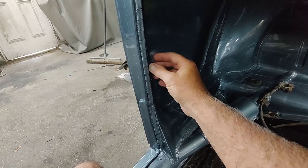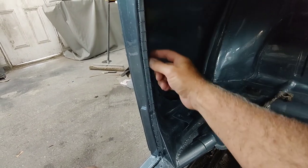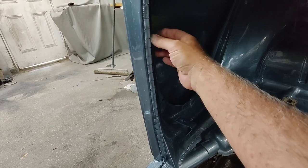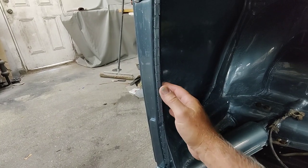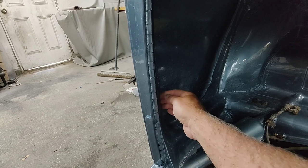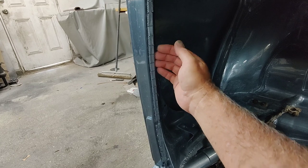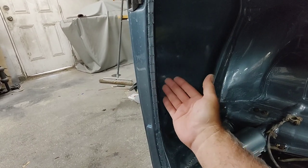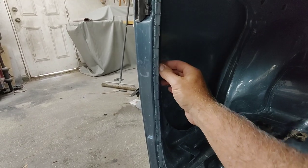Because see, this normally had that kind of a cotton foam, and I don't think you can buy that anywhere now. The stuff that they have is synthetic. It doesn't work the same as the old cotton. So you've got to use regular foam. Put it on just the surface and shape it and make it nice and smooth and straight. If your foam's all raggedy, your headliner is going to look raggedy. So you've got to make sure that your foam is down nice and tight and smooth.